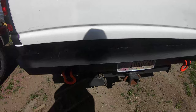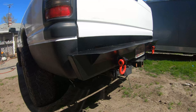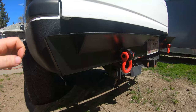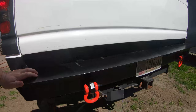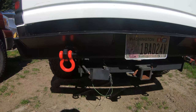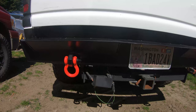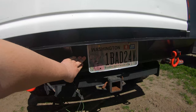Here's how the rear bumper turned out. It's the original mounts with just a 2x6 rectangle tube welded onto them — the ends are capped, plate on top, and then triangulated. I bought the shackle mounts and welded those on. The hitch is on. I really don't know how much this truck is going to tow — we're going to cut this off. I have a new mount that's going to mount on the bumper so the trailer plug will go in this gap right here.